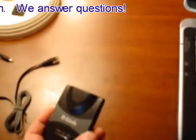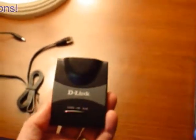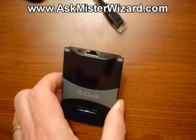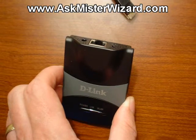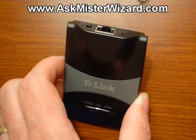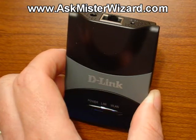Here, I have a wireless access point which I'm going to connect with the LAN. Once it is properly connected, it will allow laptops or other computers equipped with a compatible wireless network interface to use it exactly as if it were an old-fashioned Ethernet hub, except with no need for the usual Ethernet cables. In their most basic operational modes, without encryption, wireless access points operate almost exactly like old-fashioned Ethernet hubs.